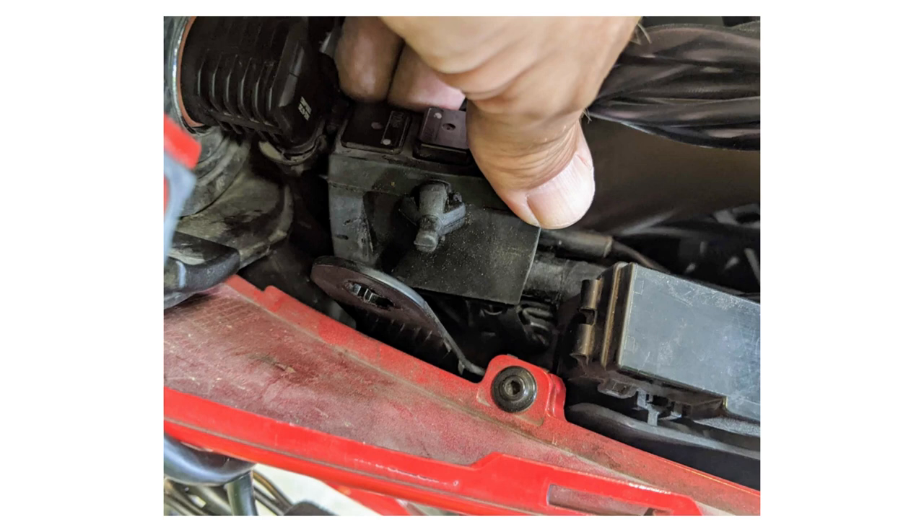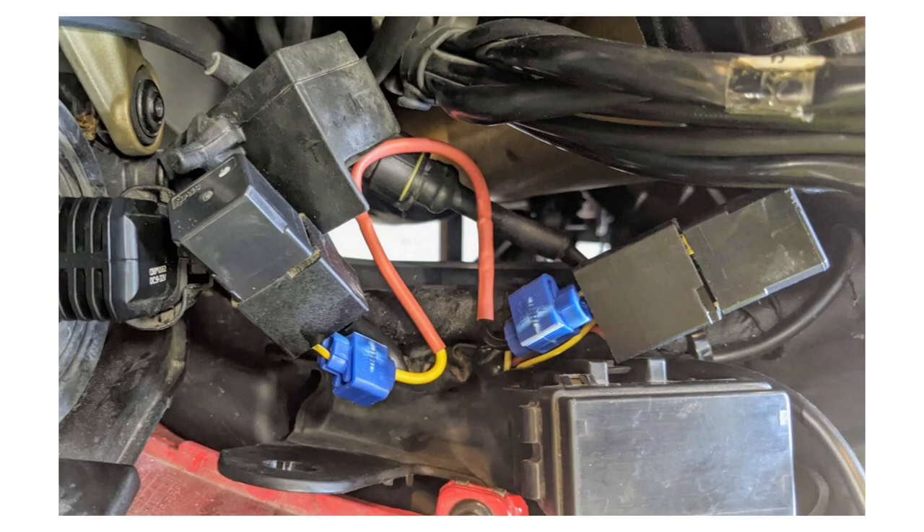It's best to unplug or remove the relay from its rubber holder. Then slice back the vinyl shielding to install the splice using the wiretaps — there's not a lot of room to work with. Be sure the wire is fully seated before squeezing the wiretap closed. Be sure to connect it so the diode stripe — the yellow wire in my example — is connected to the yellow-white wire. This is important: the stripe on the diode must be on the low beam side of the splice, the yellow and white wire. Once connected, turn on the ignition and test the headlights.